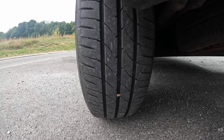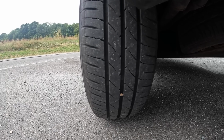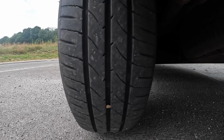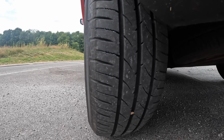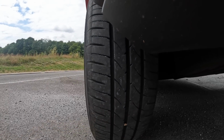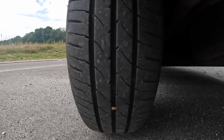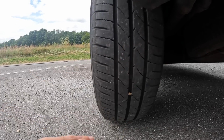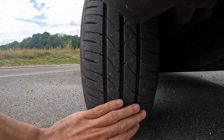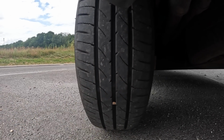The other 2 relate to the rear tyres, which, if I'm completely honest, I don't think I would advise them at all. So the advisory is tyre worn close to legal limit / worn on the edge, near side rear and offside rear. Now, as you can see, they are perfect. I would say they've probably got about 5mm across the treads, and yeah, they're nowhere near close at all. And the edges aren't even worn there. They're perfectly sort of even. One side hasn't got camber wear or anything. So yeah, I'm not quite sure where that advisory has come from.